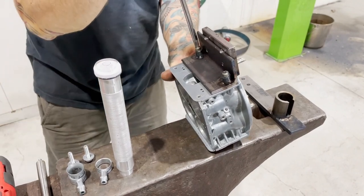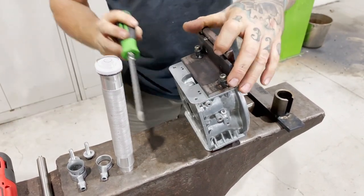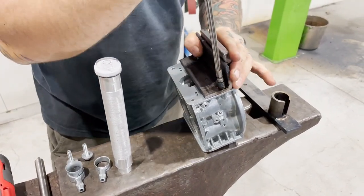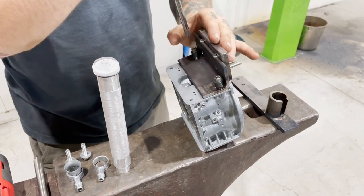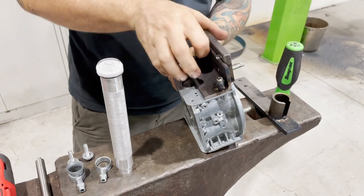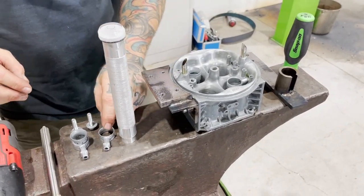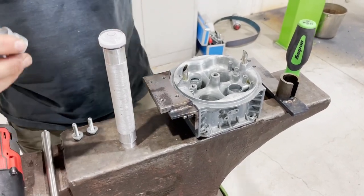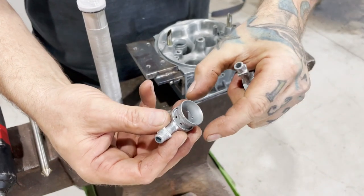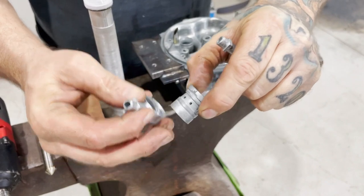Because this is 90 degrees to the base plus 90 degrees to the top, we're in the right vicinity for where we want to be — that's why I chose this surface to jig up and tool off. So there's our base starting point. Now what we're going to do: these are our booster banjos or booster legs, and this is our annular venturi which we'll push in once the job's done.